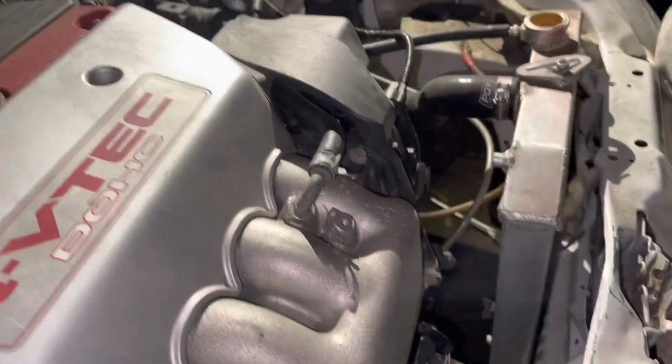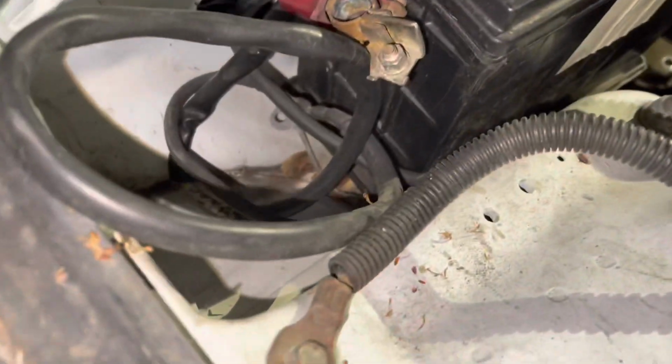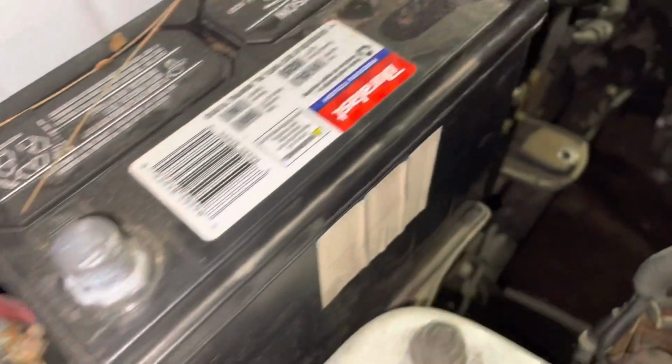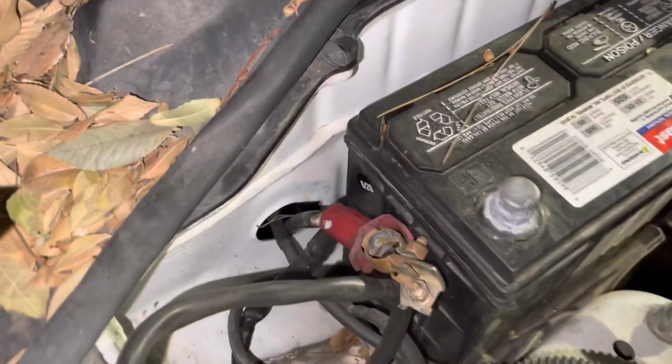All we got to do is get the little cherry picker, take off the engine mounts, which Jimmy found online. These are $104 on whatever website. We'll test them out. Want to follow where the harness goes, because I don't see any harness on this, or at least I don't know where it goes, nor do I know if it has like the conversion from this harness to the actual chassis harness. So I wanted to check that out too.